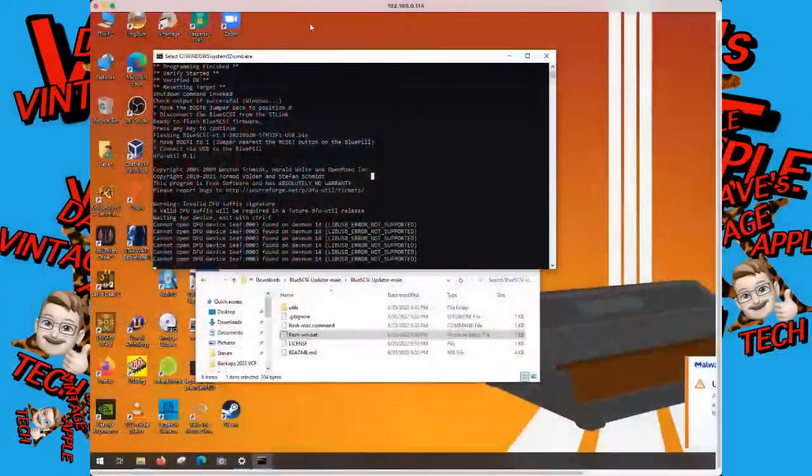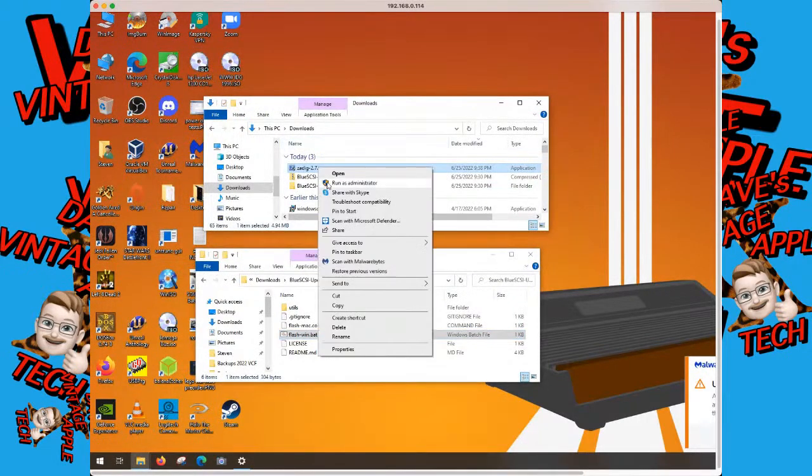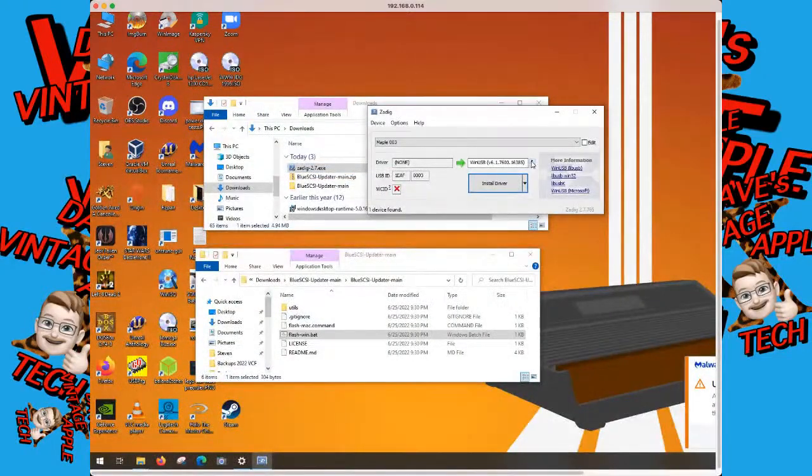Now you have to go back to the other driver with Zadig again. The upside is that because you did the first part, you can skip to the second part. It says Maple now. Now it's Maple flavored. So go ahead and switch that to the libusb. This one? Yep.